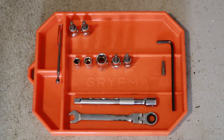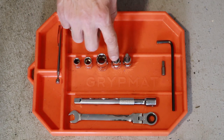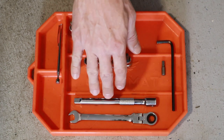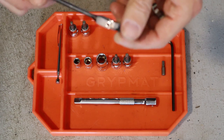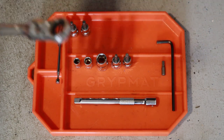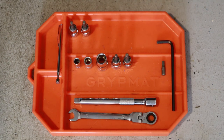Quick overview of the tools we're going to use. Per Downstar's instructions, all you need is just a 5- and 6-millimeter Allen. That is true, but in addition to that, to remove all the stock hardware and fasteners, you're also going to need an 8-millimeter socket, 10-mil, 13-mil, a T30, and a T40. A socket extension will also be helpful, as well as a 10-mil ratcheting wrench to get the bolts alongside the fender that are in a tight reach area. I also have a 5-mil Allen key and a bit to get those Downstar bolts into place in that tight fender area.